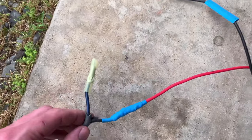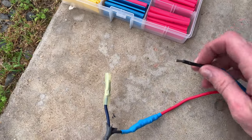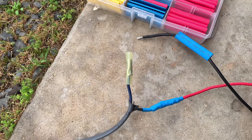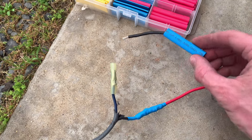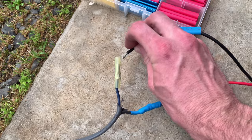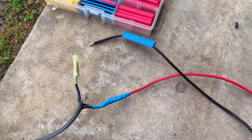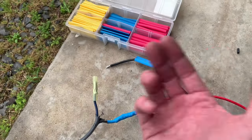I guess I just assumed everybody had used a butt splice before, but maybe they have, maybe they haven't. Basically you just skin one end of the wire — there's a metal piece inside — and you stick that end of the wire in there, then use crimpers and crimp it down. It's solid, it makes a splice, it won't come out. Pro tip: if you're going to put heat shrink on it, put the heat shrink on before you make your last connection, because there's no way to get it on after. Then I'm going to squeeze this together, heat shrink it, get some electrical tape, tape that, and then put wire loom from here to the front of the truck and zip tie it all the way up the frame to the front battery.